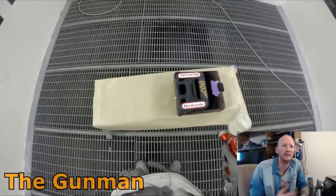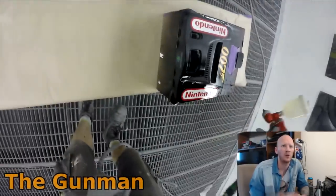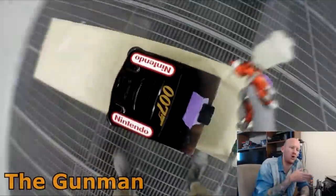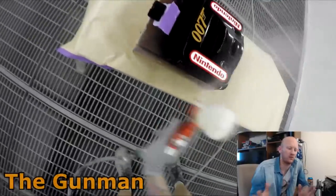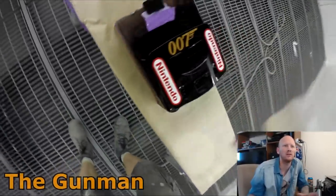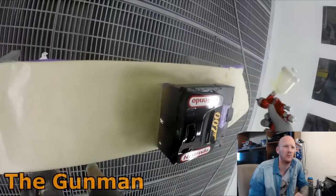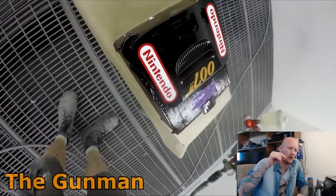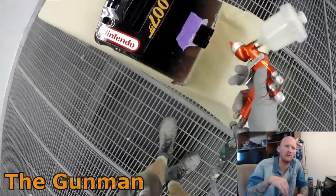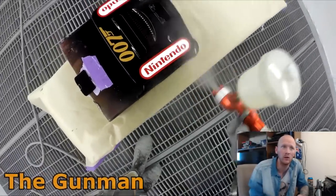There's no silicone or anything through it. So yeah, you don't always have to wax and grease everything before you paint it. But obviously, before I started working on it, you did notice that I wax and grease removered it. If this was like a full panel and I was working on it and flow coating, yeah, absolutely, I would wax and grease remove it. But for something like this, I didn't want little bits of wax and grease remover or Prepsol ending in the crevices, not getting wiped off properly. It could actually do more harm than good.